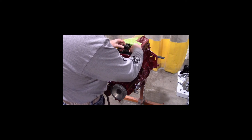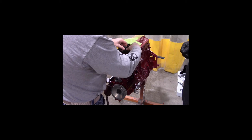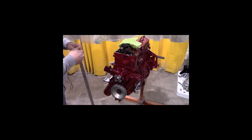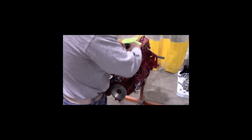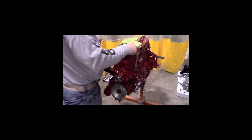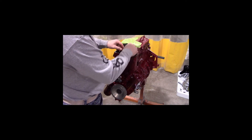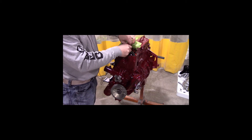We're off one tooth, but that's going to depend on our cam timing anyway. I'm going to pull this old chain off — so I'm one tooth off. See, even live this doesn't go exactly how you want to. Let's get a socket and pull the tensioner out. This may give me a chance to hold this — I'm probably going to go ahead and tie some wire, just to be safe in case this thing wants to fall on us.